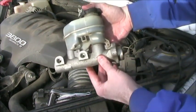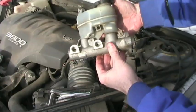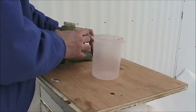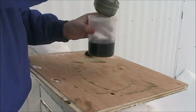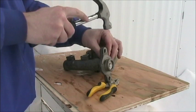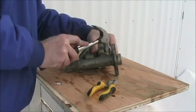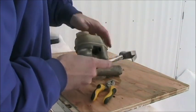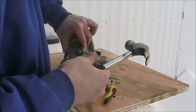What we're going to do now is take the reservoir off so we can put it on our new one. I'm going to drain the reservoir of fluids. We have to drive out — or pull out — two pins to get the reservoir off our old master cylinder. One's out. I'll probably drive this one the other way, or just leave it in the master cylinder. That puts a bunch of fluid out of the master cylinder.